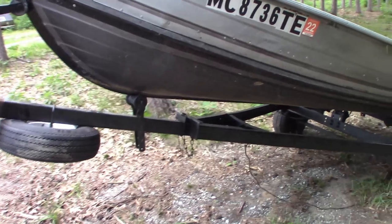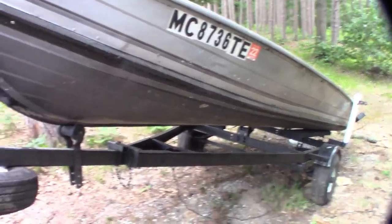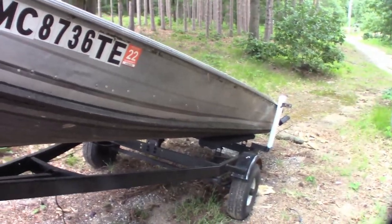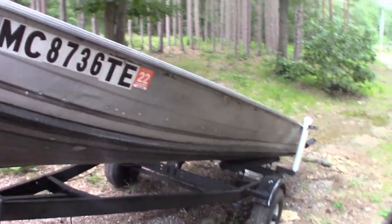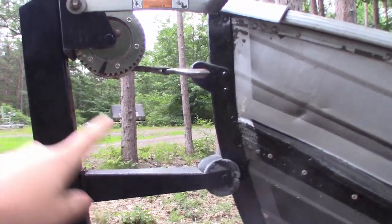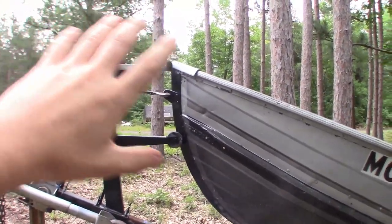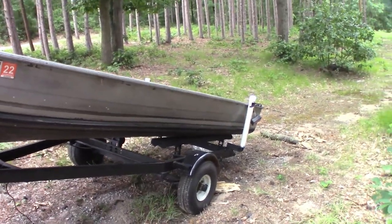I took the trailer and the boat into the garage last night to get a closer look at the damage on the trailer, because yes this trailer is actually damaged — you just can't really notice it without actually looking. I did know it was damaged before I bought it; the guy let me know and showed me. I fixed the winch positioning — the winch was down where the bow stop should be and vice versa, so I swapped those around. That pulls the boat up a lot farther up front and it's not hanging off the back so much anymore.